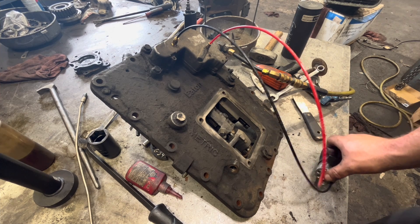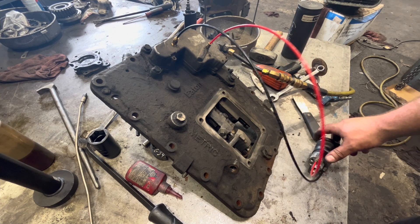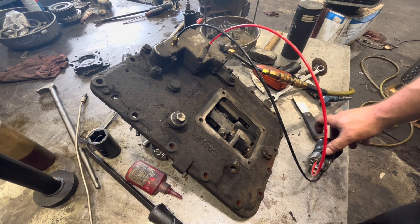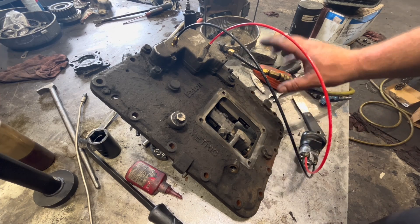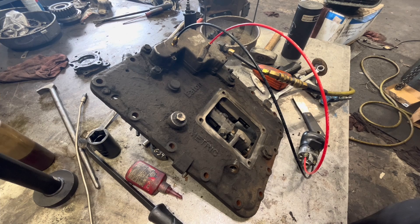But if I flip the switch, you can hear the air leaking. As you can tell, there's no range shift going on. There's air leaking out of this thing — it's going crazy. If I flip it into the high side right now, absolutely no air leaking out of it. It sounds like it's sealed up nice and tight.